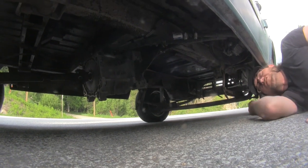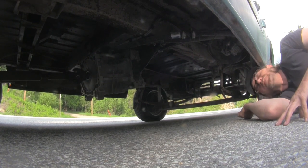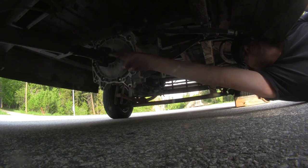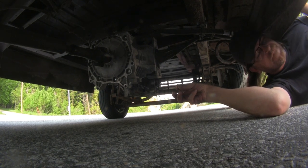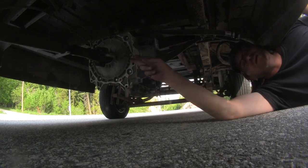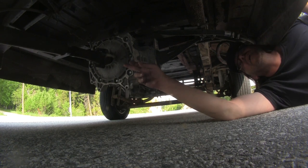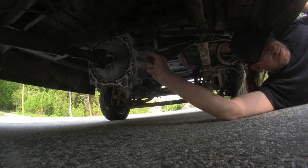Because I matched the gear ratios as closely as I did, I didn't really need to run a transmission. The Nissan Leaf doesn't have gear selectors — it just has a single-speed transmission. I did the same, only with the rear end, coupling my motor directly to the driveshaft. I did a bit of machining — I used a center from a Fiat clutch that fit the splines of the Nissan Leaf motor pretty close, drilled the hole with a drill press as centered as I could.